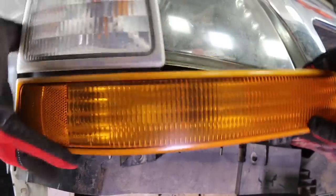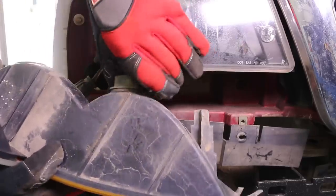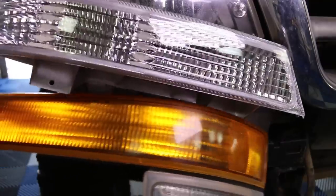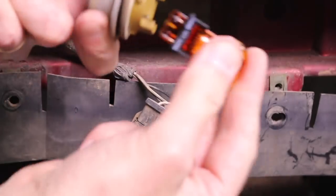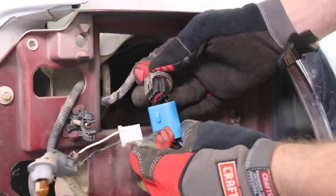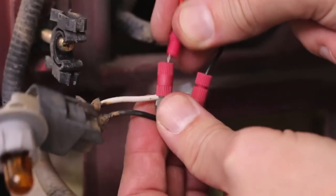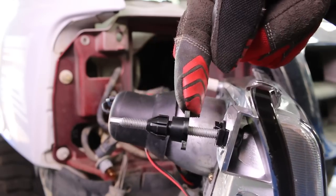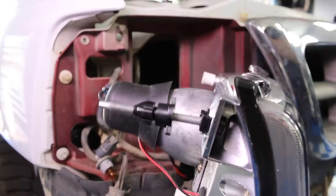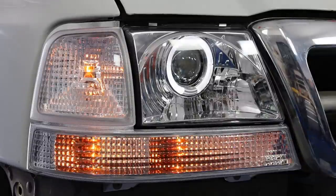All that's holding the side marker lights on are two fasteners at the bottom. Grab a Phillips screwdriver, remove them, and it'll come free. Then all you have to do is twist to remove the three bulbs. The problem I caused myself by going with a completely clear side marker light assembly is that the factory bulbs are clear, so I had to pick up two amber bulbs to keep my lights street legal. To remove the headlights, just give them a firm tug and they will pop right out. Install the Spyder Auto light using the factory connector. To make the LED halo functional, connect the black wires, then the red to the white wire — I used PosiTap connectors. Make sure you align your headlights before hitting the road at night. What a huge difference from what was there before — gone are the mismatched headlights, Cyclops HID, and hazy lenses.